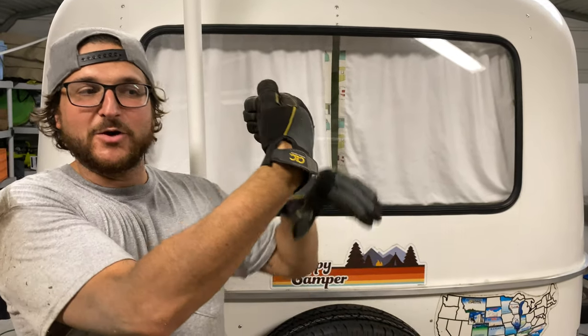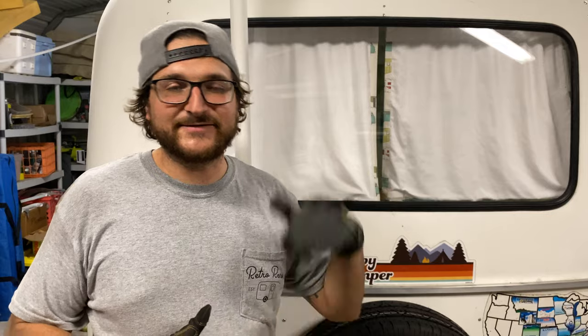Yeah, there could be many reasons why you need a new axle. One is safety — making sure your camper is safe on the road. If you are feeling every bump and your camper is feeling every bump, it's probably time to replace an axle. If you see your rim going under the wheel well, then it's time to replace your axle. Also, if it's feeling every single bump and the only thing absorbing it is the tires, you're going to have a problem down the road — things like cabinets will start breaking and bolts will start loosening up.